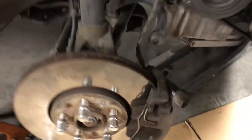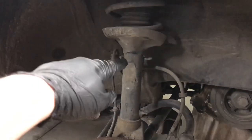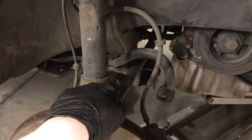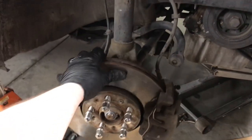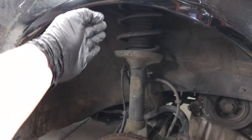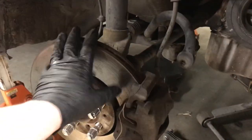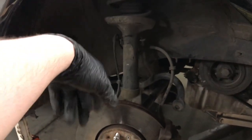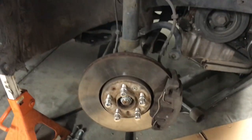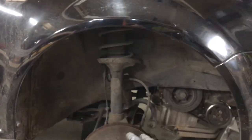I was going to start removing the coilover, but I can't yet. If you try to mess with the shock to get it to come down, there's a high chance you're going to pop the axle out from the transmission — and that's a mess I did not want to deal with. So I'm going to put the control arm back in first, so the control arm holds on to the knuckle via the ball joint at the bottom, and that way when I get the shock down, the bottom won't pop out and pull that axle. Keep that in mind if you're doing this yourself.